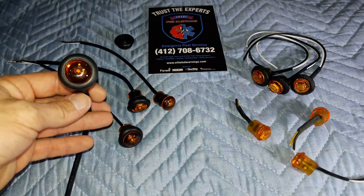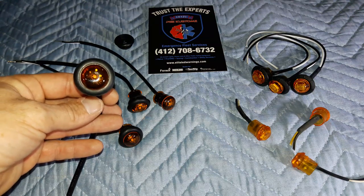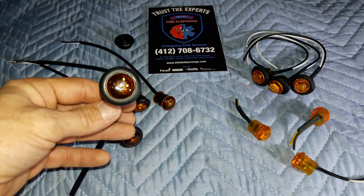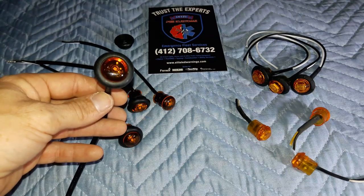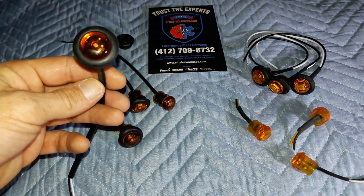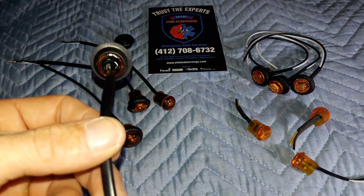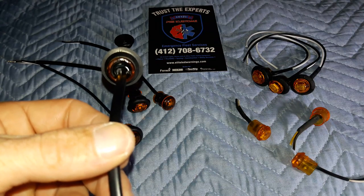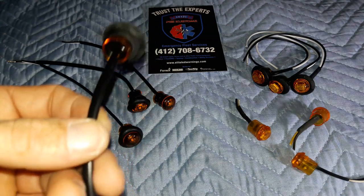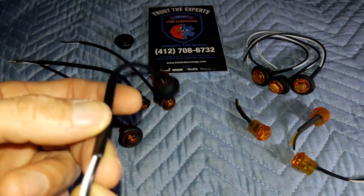Now let's get to the Technique S34. Right away you will notice there is no fluted wide-spread lens — it's just a nice dome-shape PC lens. You'll notice there is one itty-bitty little diode in there. The reason for that? That single diode outshines those three. Now here's the important part: when you look at it from the back, you can see it's epoxy filled as it should be, and of course it's black as compared to their clear — but that's not the key difference. Number one, the lead that comes out of the body of this light is a cable.